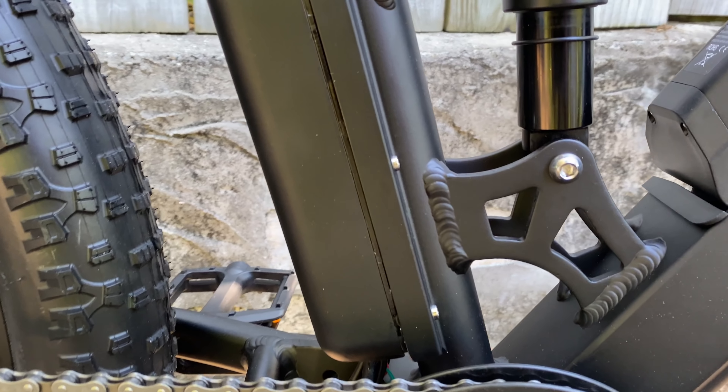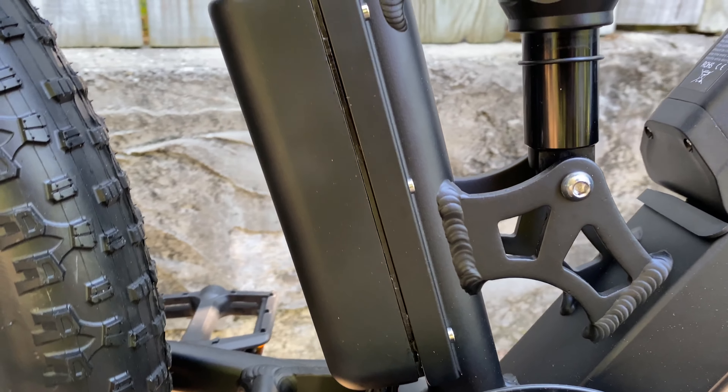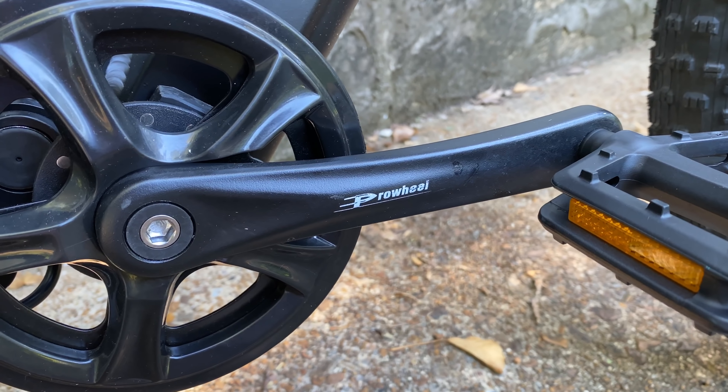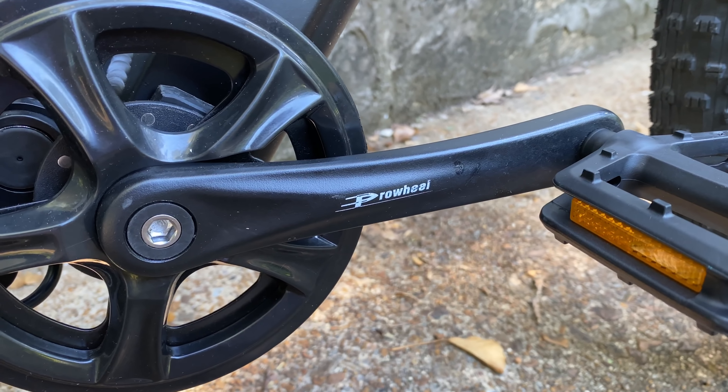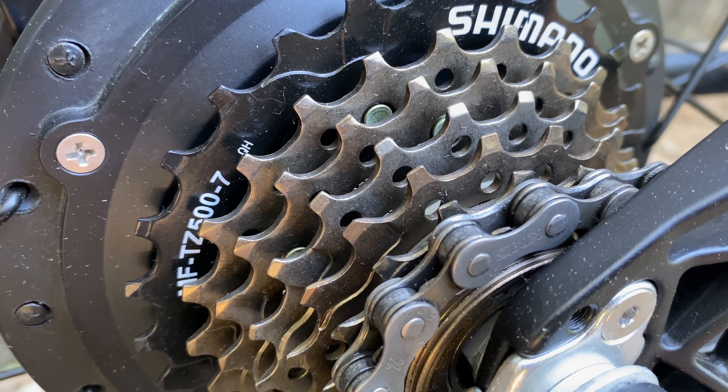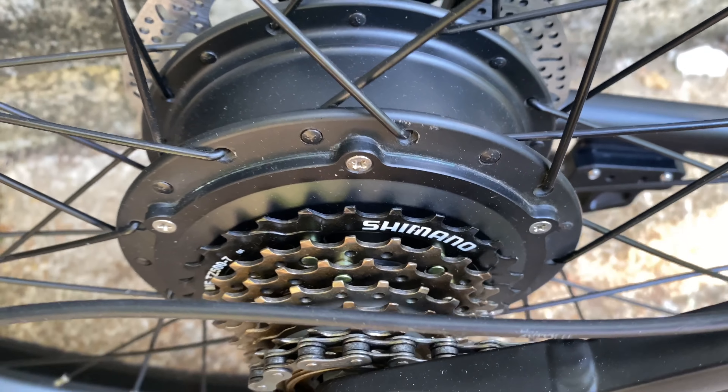The rear frame is all about the full suspension. This bike comes with an Exoform REA5 shock — an air shock, which surprised me — with reportedly 40mm of travel. All the welds look good. The shock mounting and pivot system looks a lot like the one on the Hyper Hydroform, but on steroids. The speed controller is bolted to the back of the lower seat tube — nice placement. The drivetrain has standard plastic pedals, 170mm Pro Wheel crank arms, a 36-tooth one-by chainring connected to a Shimano Acera derailleur, with a 7-speed freewheel running 14 to 28 tooth.